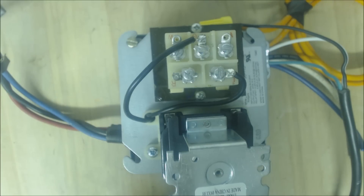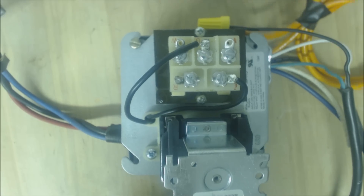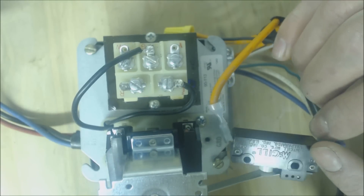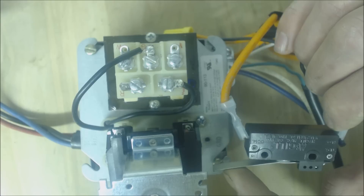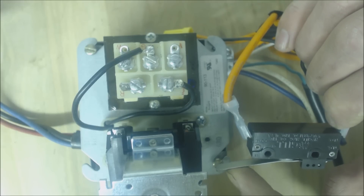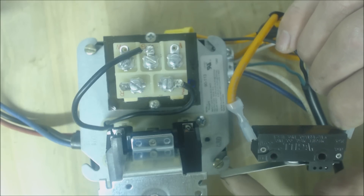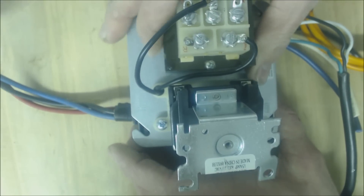So we're going to go ahead and take a look in here and look at the voltage path. We have our hot coming in — it gets connected to the end of the door switch. This door switch is normally open from here to here, which means if you took a resistance reading with the power off and the wires off, you would get OL. When you click this button in, you should get a resistance reading of 0.0 ohms. If you're checking it with the power on, check with your voltage AC, put one probe here and the other on a common or ground, and you should have 120 volts — same on the other side because this switch will be closed. Once you're past this point, it comes into this fan control relay.